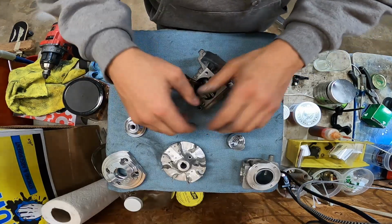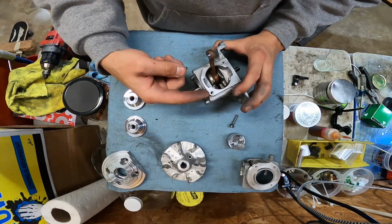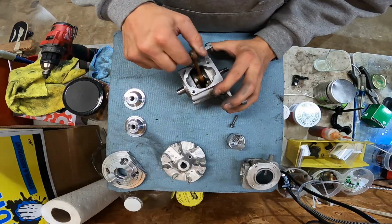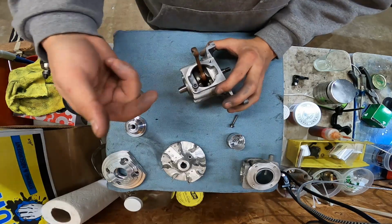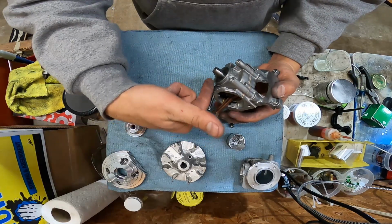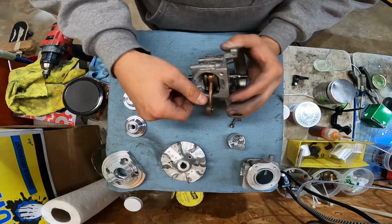I have actually lost engines due to the fact that like red Loctite or something had, not on this engine specifically, but like jet skis and stuff, a piece of red Loctite would actually still be down in the threads, and you put a bolt in there and you would torque it against it. You'd knock it out and it'd go to the bottom, and the bolt would torque against squishing that piece of junk at the bottom, and you get a false sense of torque, and you got a cylinder that lifts.